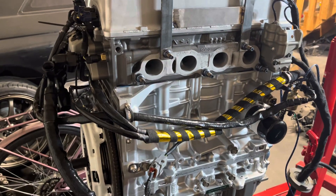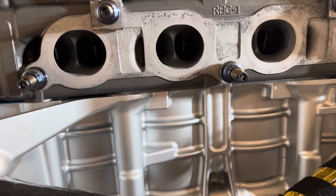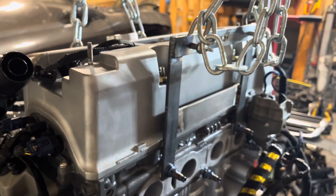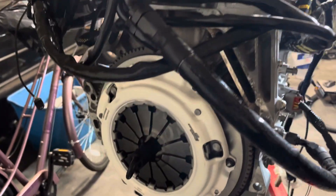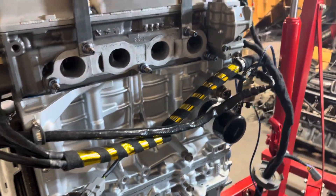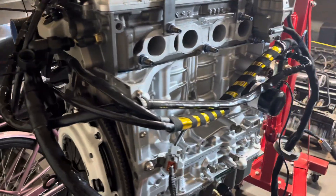This is our boosted K24 going into the CR-V chassis. We did a fully ported head and intake — basically the entire engine has been ported. Everything has been Cerakoted. I've got a crappy valve cover on there right now, just something to possibly get scratched. Running Clutchmaster stage 3.5 — no more eBay clutches if you've looked at my previous videos. All this electrical is a CR-V harness, but converted for 6-speed with reverse lockout.